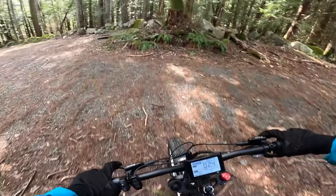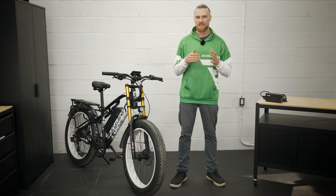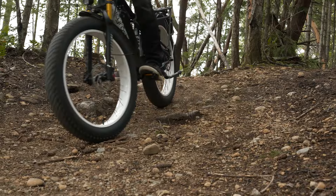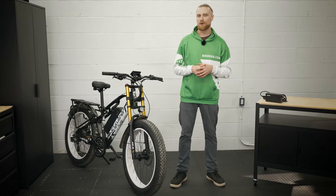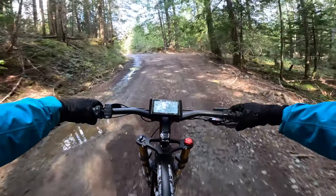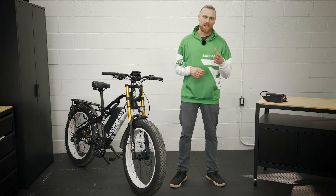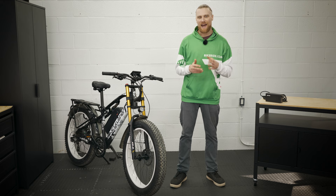And now taking a look at the cons. Our first con for the XF900 is the fact that this is a pretty clunky bike. The bike's style inspires it to be ridden off-road, but as soon as you start to venture away from smooth terrain, you're going to notice some uncomfortable noises. I found the XF900 to be a very clunky bike, with many of these sounds emanating from the suspension and the fenders as you rode over any kind of uneven ground. The suspension clunks and clacks as the front and rear wheels impact rocks, roots or dips, and is generally very loud and unresponsive. Then the fenders clank and clack with impacts as you ride, and despite tightening and adjustment, they just seem to move around. And finally the chain slaps away over any kind of bump, adding to the symphony of noises.